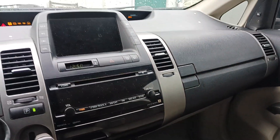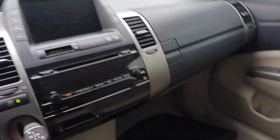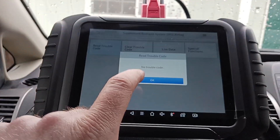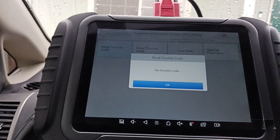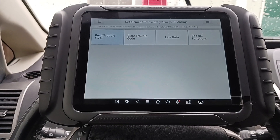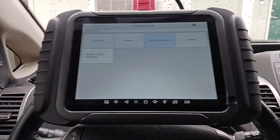So it was an accident, no airbags deployed. Nothing was replaced, but maybe the sensitivity of the seat scale underneath — which is a little black box with two connectors — was thrown off, or something wasn't reading correctly from what the computer wants to see. If you don't have a decent scanner, you'll probably have to go to the dealer, or you can pick one up and do the calibration yourself. Hopefully this helps someone out — it worked very well.